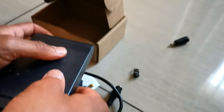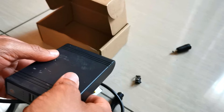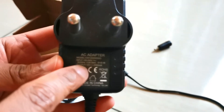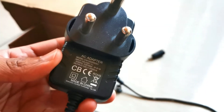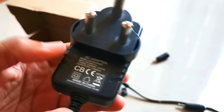What you need to do is check the power rating on your router — your 12 volt AC DC adapters will become redundant. The power rating on your AC DC adapter will indicate whether it's 12 volt or 19 volt. The majority of routers out there are 12 volt, some of them are 19 volt. If it's 19 volt, it's not going to work with these UPSs.